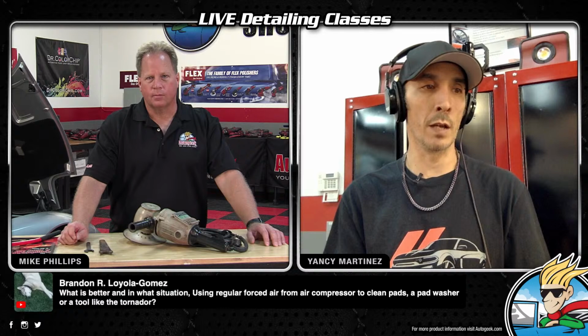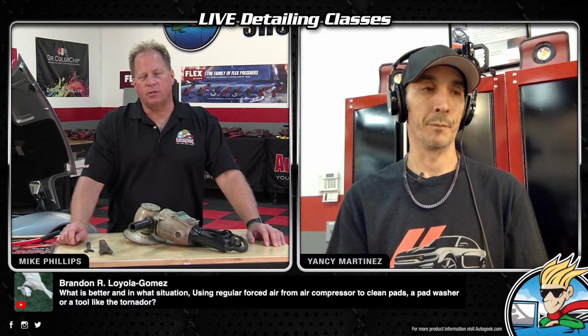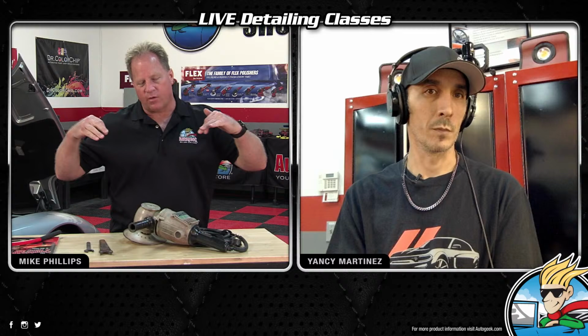Brandon, again, what is better in what situation? Using regular forced air from an air compressor to clean pads, a pad washer, or a tool like a Tornador? Well, the only time I like to use compressed air of any type is on microfiber. Foam, you're going to shove everything into it. So microfiber or wool, yeah. Fiber pads. But when it comes to foam, forcing whatever you're trying to clean off into the pad just doesn't make sense. Me, I throw everything in the wash machine.